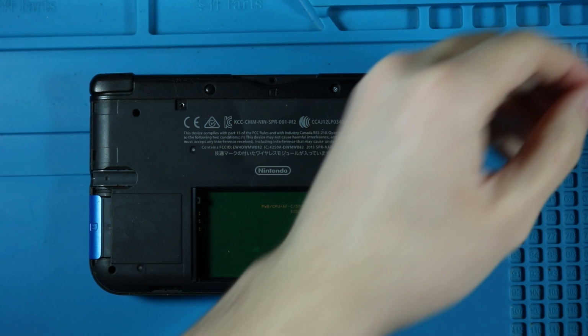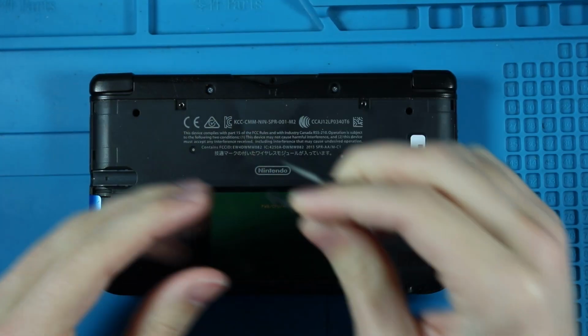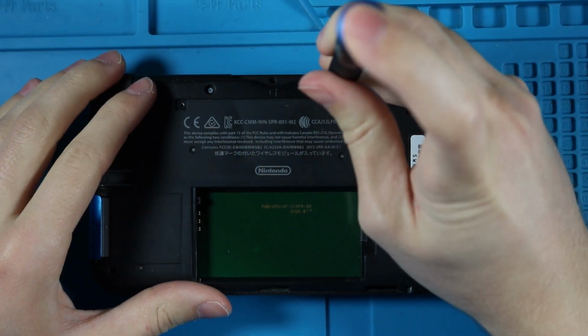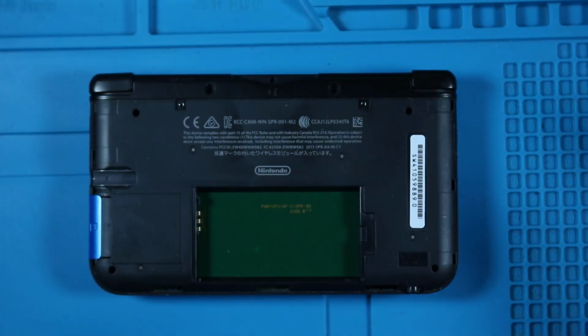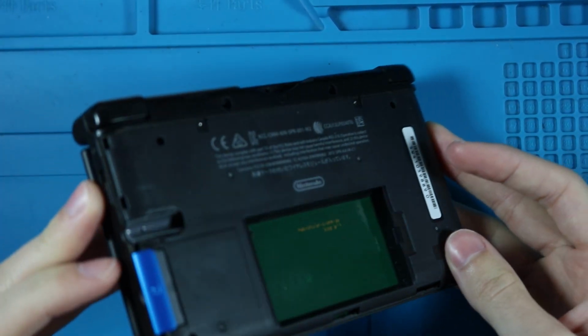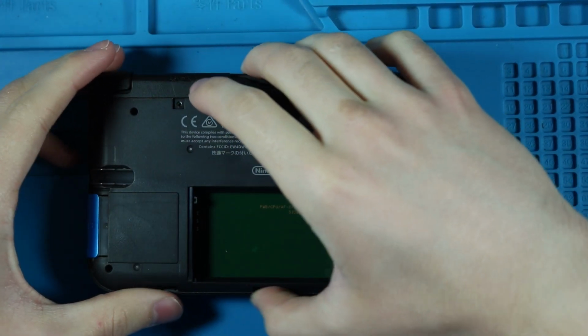If you're ever taking anything apart that doesn't have a teardown guide online, literally just look for any screw post that you could find, and if it's still not opening up once you think you've taken everything off, there's probably some screws hidden underneath rubber pads like that, or even just plastic pads. So that is all the screws for this.